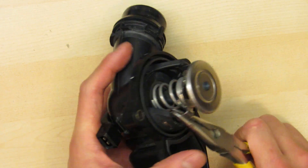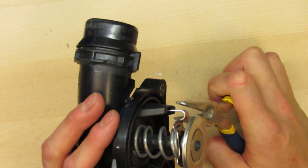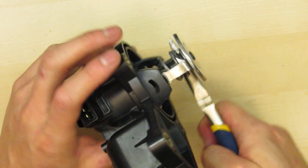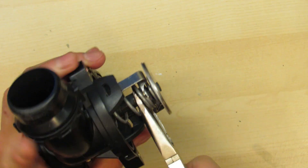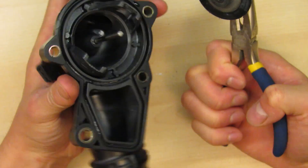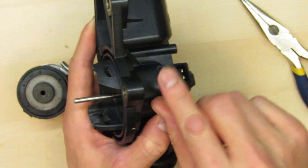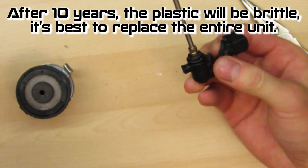To do that, all you've got to do is pop this off — put your hand in front of it because there is some spring force. It just comes off the shaft, and that's the heated shaft so it's still kind of hot. The shaft and heater element has a little clip here — you just lift up on that clip, mine's broken off — and then you just pop that shaft off.